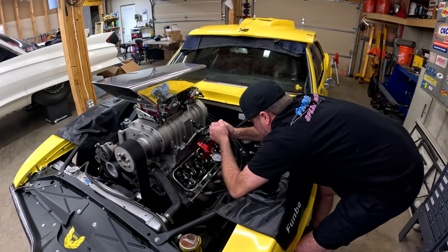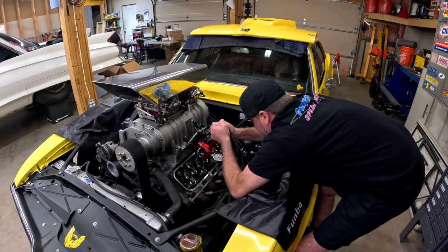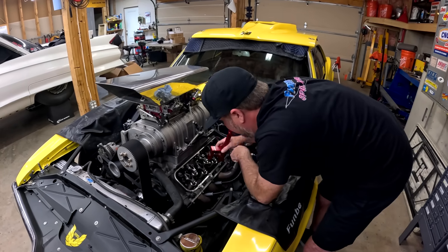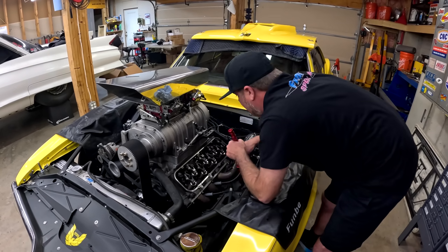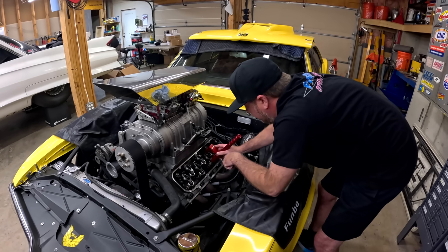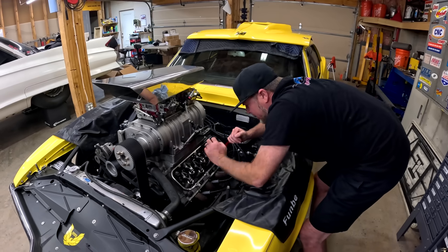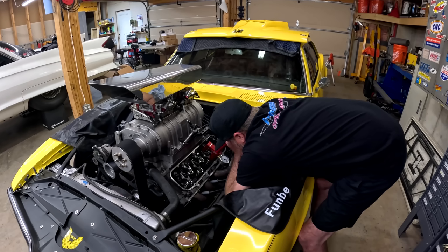Okay, so that one breaks off the seat at about 140 PSI, which is not a lot, 140 PSI of seat pressure. So what we're gonna do is I'm gonna find if there's any others loose, compare them, and if they're not similar, then I'm gonna go back and start rotating the motor and double check that everything is actually on the base circle of the cam.